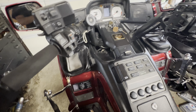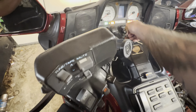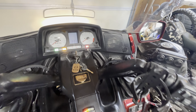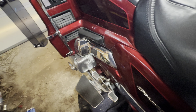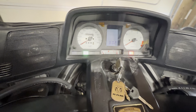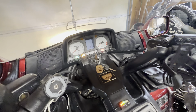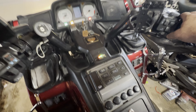I have run it today so I don't think I need the choke, but if it doesn't start right away you just hit the choke and it's good to go. I'm on the center stand right now. One of the cool things about the Gold Wing — it lets you know when the side stand is down. I can bring the side stand up and the light goes off, or put it back down and it's good to go. Don't put it in gear with that yellow light on — it'll stall the motor immediately.